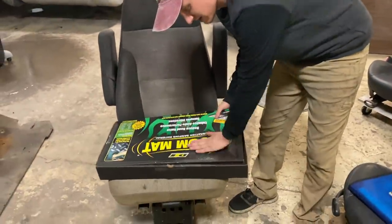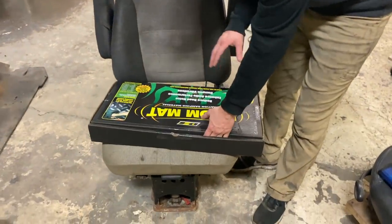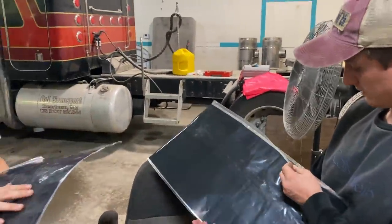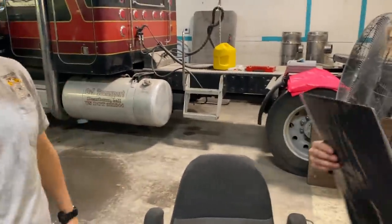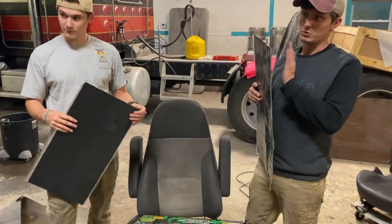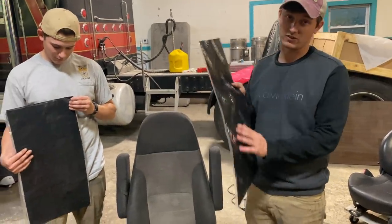We had our little brother Ethan stop on the way home and pick up some brand new boom mat — it's kind of like the same thing as Dynamat, just a different name. We did get a lot of it. This is one of the biggest boxes they make. We've never really used this stuff before — in one of our vehicles we put it in for the door speakers because we had a little bit of rattle. All it is is just big sheets of a tarry substance almost, and it's meant to reduce any kind of vibration or noise. We got 30 of these sheets in this box and we're hoping that should do us up for the cab. We didn't know the floor was already done, which means less we have to use here and more we can repurpose — either doing a lot more on the doors or putting a lot more on the sleepers. We're going to go ahead and start sticking this stuff on — first time using it, so let's see how it goes.